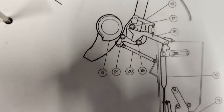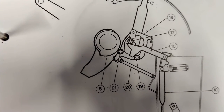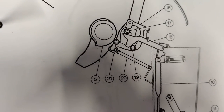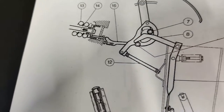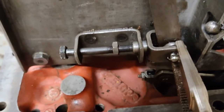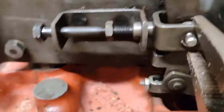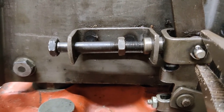It's a bit fiddly, but you can get that vertical lever in place. And once you've done that, it's actually relatively straightforward to slide the support bracket and the cylinder back in. If you've not got that located correctly, and that located correctly, it is very difficult to get the cylinder back in. Just to make sure that that clevis lines up with the adjusting screw, usually I just get a pair of vice grips onto the edge of the clevis, pull down until the thread lines up, and then that should thread in nice and easily.